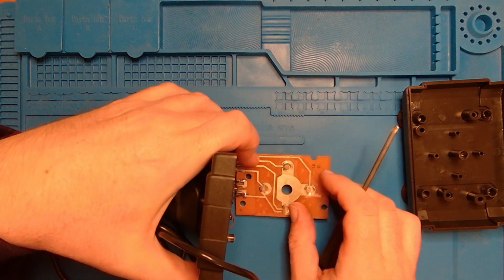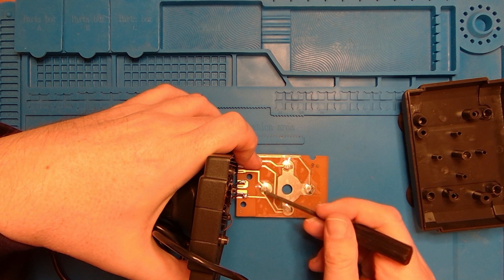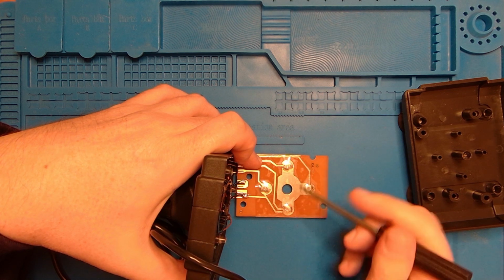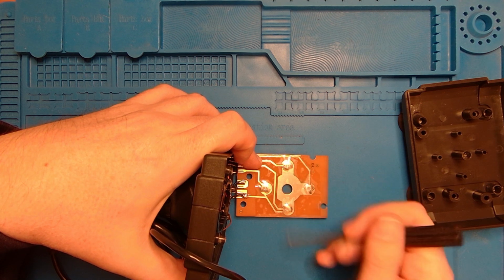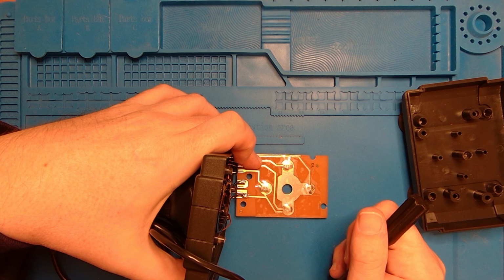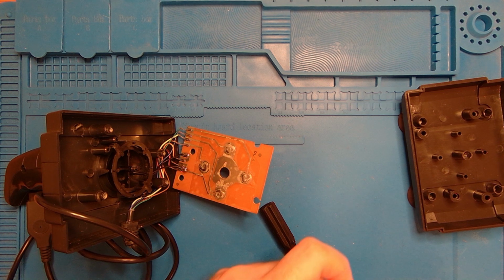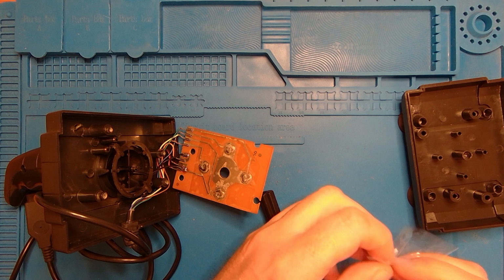So in order to fix this, what I will need to do is replace these domes. Take the tape off first, replace the domes, get some contact cleaner behind there, because you've probably got, what, 20 odd years worth of gunge behind there. I don't know where this has been stored. Give it a clean, put some new domes on, some new tape on top, and then hopefully job's a good one. It just so happens, anticipating this, I've purchased some of the domes in question. There we go. 10 in there off eBay. I only need 5 for this repair.